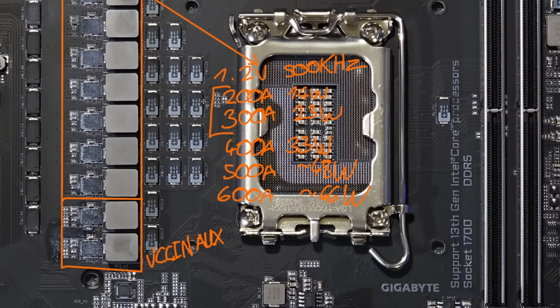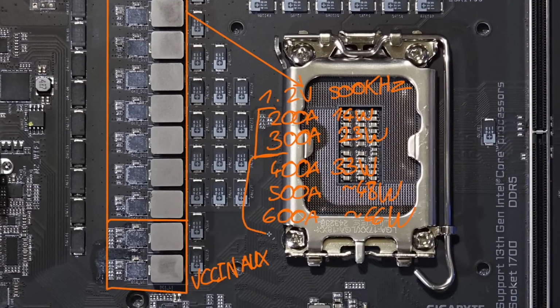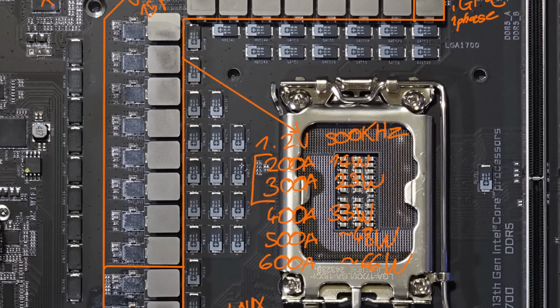Cinebench is very short. Y-Cruncher, at least the configurations that people regularly run, is seconds. There are versions of Y-Cruncher that would run for many, many minutes, but nobody benches those on LN2, so you don't really have to worry about that. So at this point the VRM cooling would start becoming a concern, except you're also running your workloads for such short periods of time that you're not going to have time for the VRM to get up to a high temperature before the workload finishes.